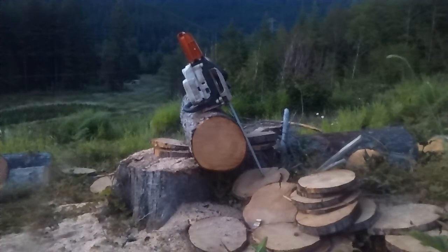It's got a 7.2 spur sprocket on it. Just blew all this saw out, sharpened the chain. The only thing I had trouble with is when we got it, the kill switch wire would pop out, and so you'd cut it off and it wouldn't die. You'd have to choke it to kill it. I fixed that just by bending the wire a little bit more, and never had it come out ever since.